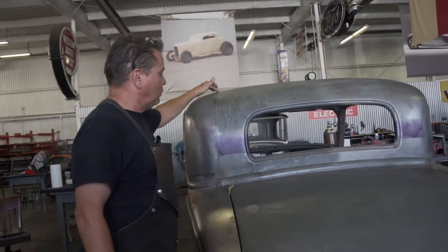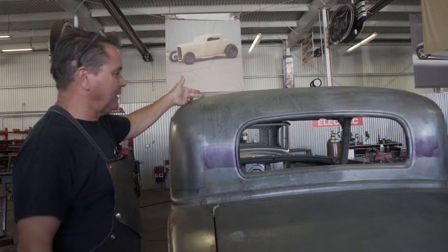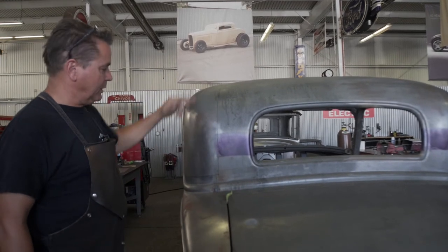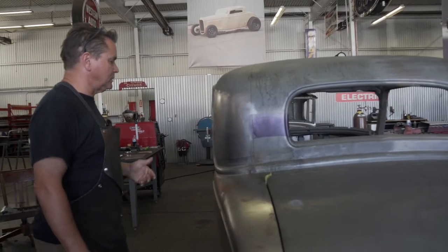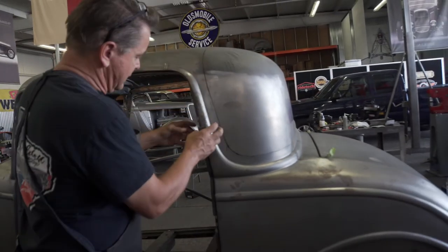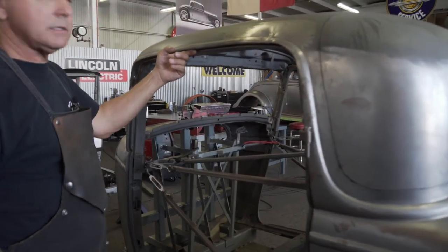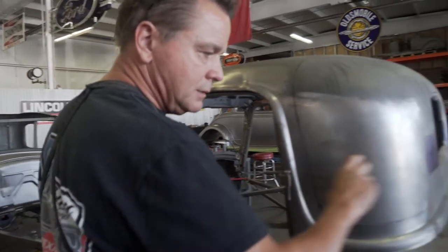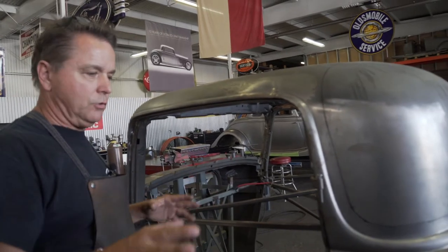But if we're doing a Brookville car, we're going to have to weld this seam anyway, okay? So you can't even figure that one in the equation if you're doing a Brookville car, because you've got to weld it anyway. So now you've got one here and one here, which is the same as a cut here and a bunch of little cuts here. Also, the other thing that it helps us do is when we're chopping this area of roof right here, however much it's going to be, because like I said, we're going to have our doors back. We'll mount the doors back on here. There'll be blocks sitting right here on top of this, 3/16 blocks. And we're going to bring the roof down to the door, whatever that is. It doesn't even matter what that is, because like we said in the first video, we're going by that door profile.